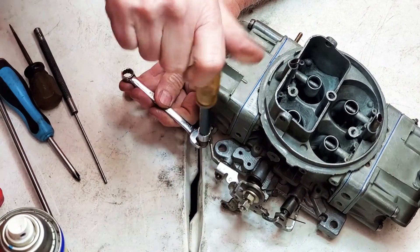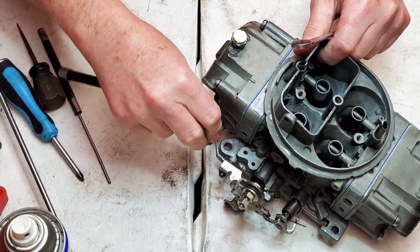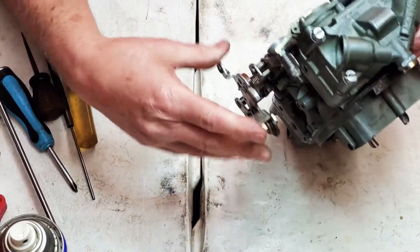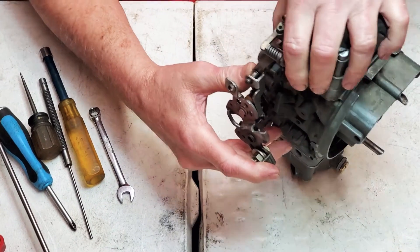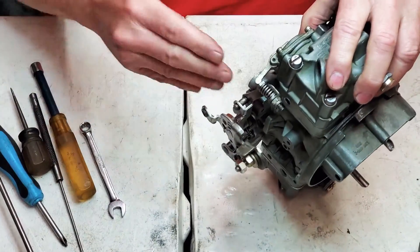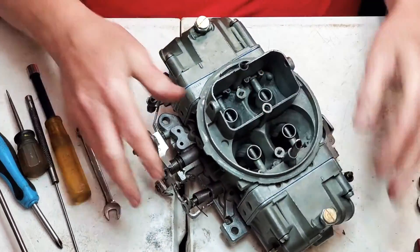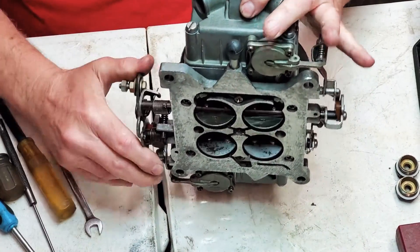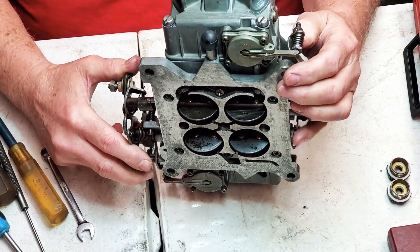What we're going to do is hold the bottom with the three-eighths and then screw it counterclockwise. That sounds crazy but you're actually lengthening it when you back it off, and we want to go wide open throttle. See that plate right there? We've got to have that - if it didn't have that plate it could bind the actual throttle and we don't want that. Now we don't have that plate here. Let's see how we're looking clearance-wise - we're good there too.